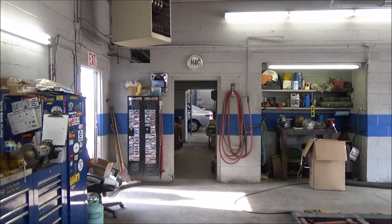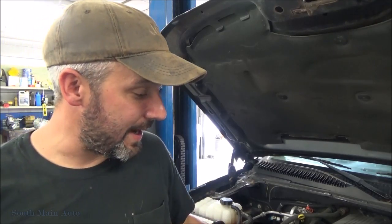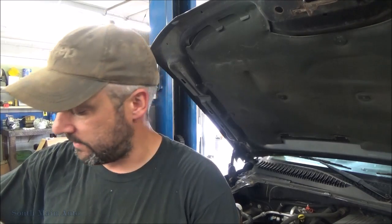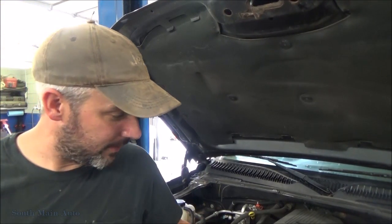So Ohm's law would tell us at 14 ohms, at about 14 volts, would be about 1 amp, and that's what we saw. And we also saw approximately 4 ohms at about 14 volts, about 3.5 amps. And that's what Ohm's law tells us also. So everything is affirmative, it's all confirmed. This little guy needs a new injector. And I'm going to go with just one injector, unlike the Corvettes with those Multec injectors where we always do all 8. Ouch. Just got jammed by my probe.